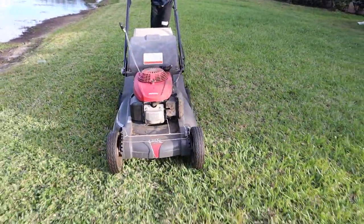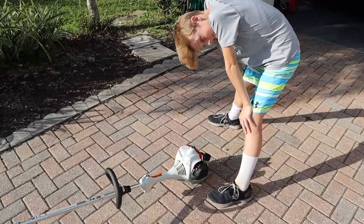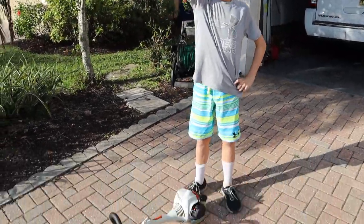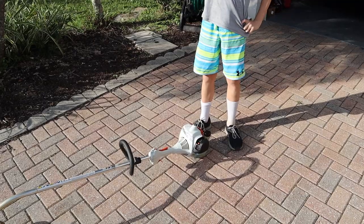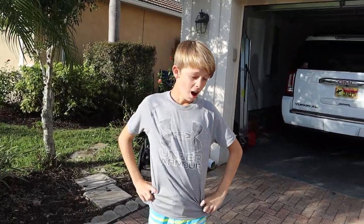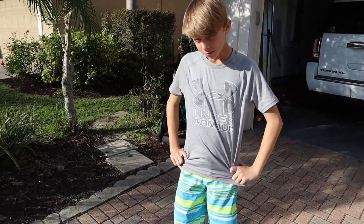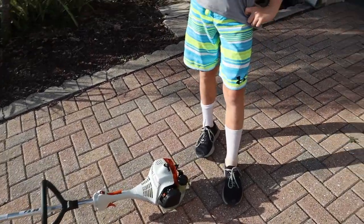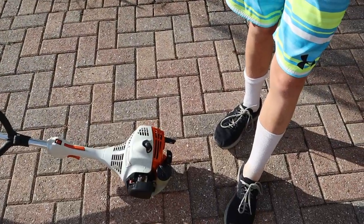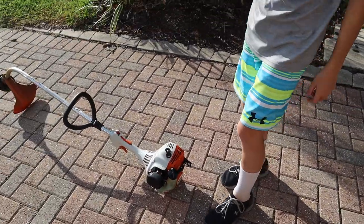So Colin's gonna learn the weed eating. Now, this is different from the mower because it's a two cycle, so it uses an oil and gas mix. So do not put the same gas. It's got a special gas tank over there in the garage, okay, for it. So check, make sure we got gas like you would do with the lawnmower.